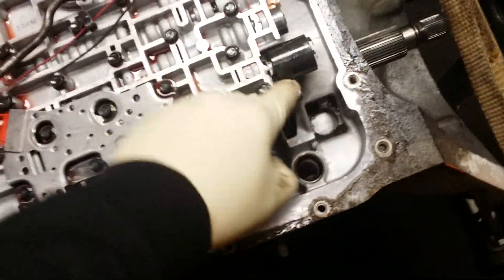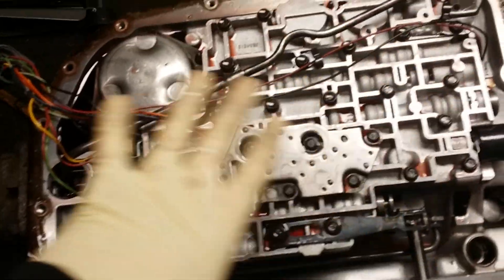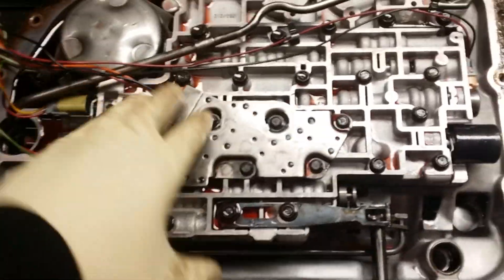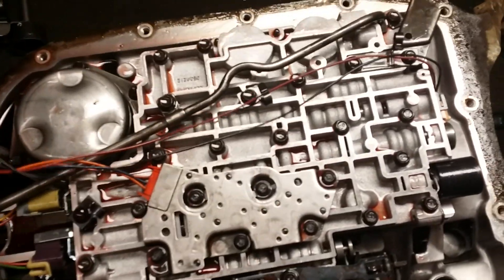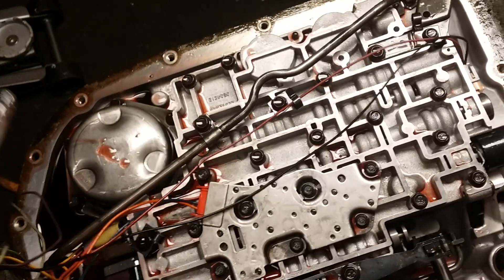When this thing's not connected, you have full line pressure — perfect for racing. I don't know how it's going to be on the street. If you've got a fresh transmission with some hardcore clutches and everything built to the hills — full race — that car will not be fun to drive on the street. But a junkyard dog that was rebuilt at some point and taken good care of is going to have some pretty firm, snappy shifts. This here I believe is just a temperature probe — you don't need it, you can just cut that out.